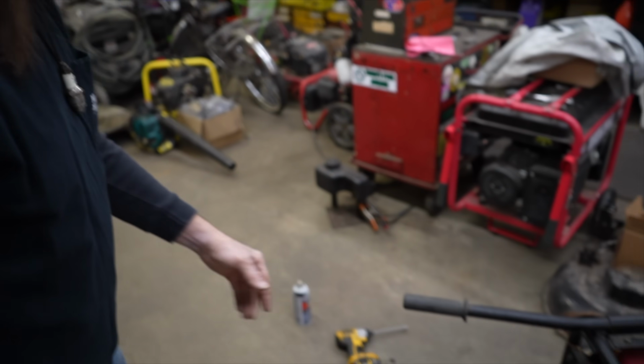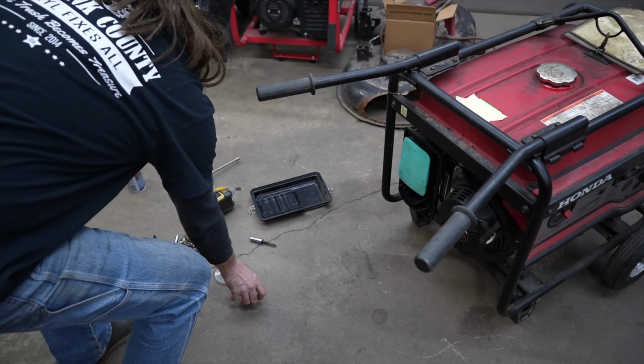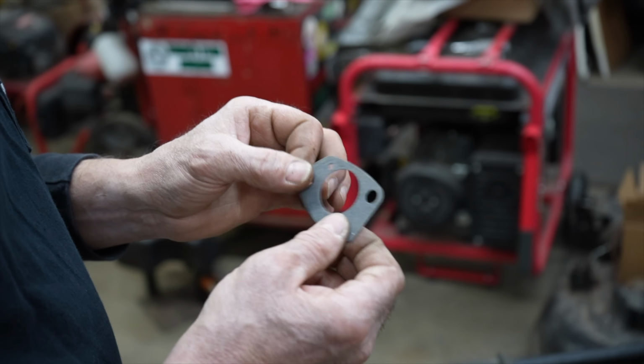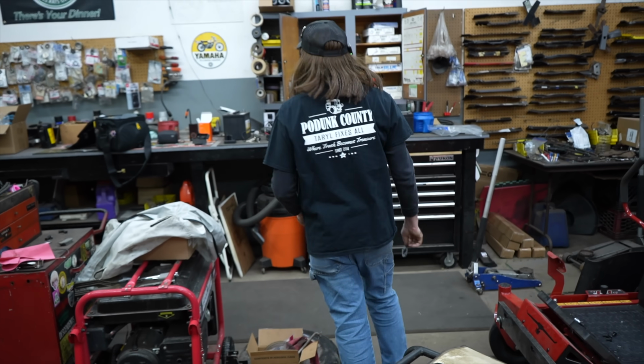That's typical repairs that come in. Somebody tries to do it themselves and they don't get something just exactly right when they put it back together, or they add too much. I've had them come in to where they've used the wrong gasket for the wrong model engine, because some of these kits will come with more than one gasket, and it didn't fit right on this manifold.